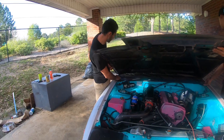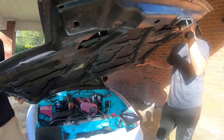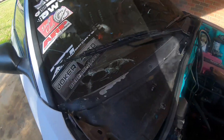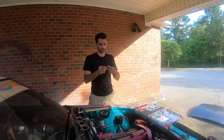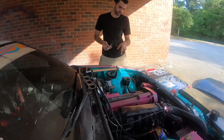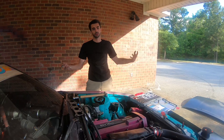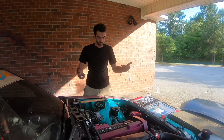We are currently taking the hood off. Because if you're working on engines, just take it off — it's so much easier. Or it can fall back onto your windshield and you'll have to replace it. Alright guys, so currently what we're doing right now is we're actually going to take the turbo and manifold out. We're just undoing the coolant lines, taking the actuator out because it's blocking one of the coolant lines, and then we're going to assemble it together correctly and put the whole thing back in.